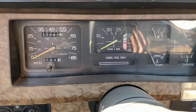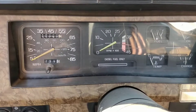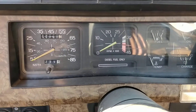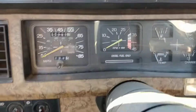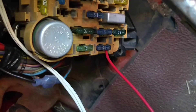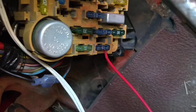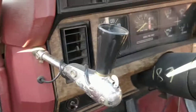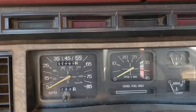Got the fuel pump installed and temporarily wired — I just started the truck so I know it runs with the factory pump bypassed and just on the electric pump now. I got this in temporarily, but that 15-amp fuse right there — that circuit will run while the truck is cranking, so it keeps the fuel pump running. I just have the wire run into the fuel pump. Let's test her out.